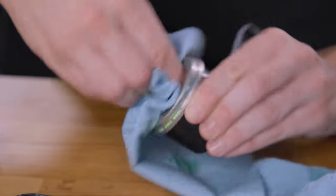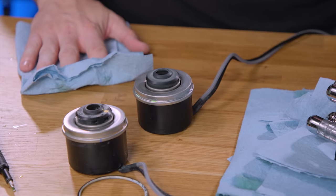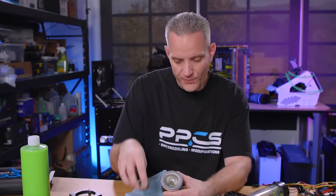If we just sort of dry this out a little bit more, get that bearing nice and clean, it should start right up now. So what would have otherwise been just thrown away is now ready for service — almost ready. Take some distilled water, take a bottle brush, clean it out, whatever method you want to use. Just clean out the inside there where all the gunk can get built up and rides on this little white reverse bearing. These are like $80 a piece — that's not cheap. That $80 is now going to be living on inside of Skunk Works.